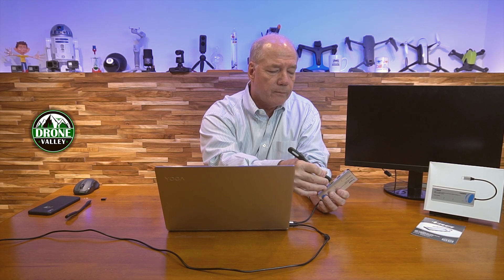Just to show you that they're powered, I've got two small USB lights right here. Let me plug those in and show you that they light up. You can see that I've got five volts going to those two ports. And here's the second one. You'll notice for a second that the display blinks out because when I plug those in, the hub itself has to recognize the other external devices plugged in, so it's going to readjust for a couple of seconds. But anyway, both of these are lit up — five volts to both ports.